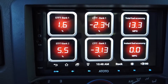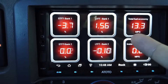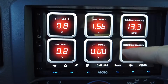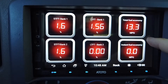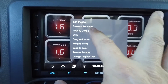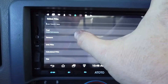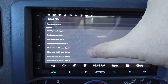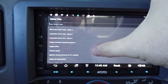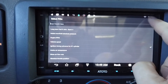You can see the values change if you give it gas, but you ideally want to check them while driving down the highway at a consistent speed. I also usually add a gauge for ignition timing — tap the name, go through the options, and find 'Ignition Timing for Cylinder One,' then hit Done.